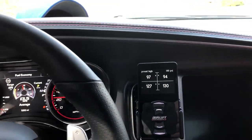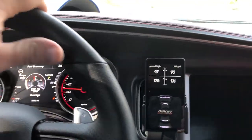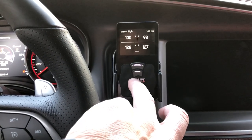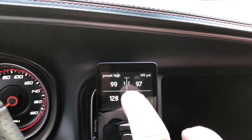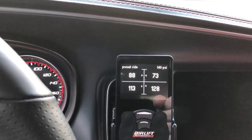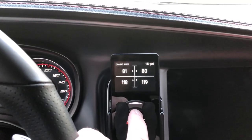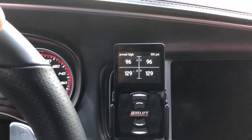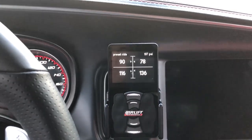Right now I've got the car just set above regular ride height. We preset the ride height and then I took the car to go get our alignment done, so I know exactly where my ride height needs to be. You hit the center button — that's going to be your normal ride height. You can see the green little arrows; those are your height sensors. Hit that and it tells you where they're at, where you're going to go to. Double tap and we just aired down, dropping to regular ride height. If you want to bump back up just a little bit to get over bumps — like my driveway, it's pretty rough — it brings you up just enough so you're not scratching. Then drop back down. Very simple: one tap and then double tap.